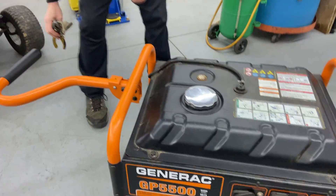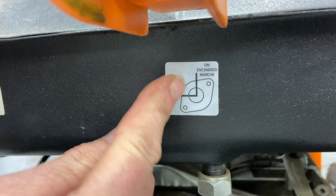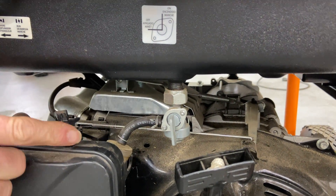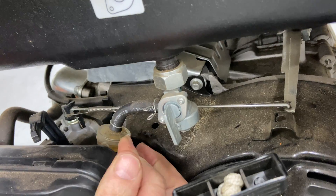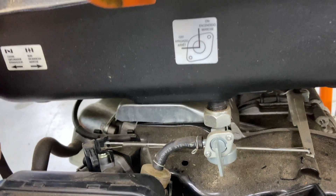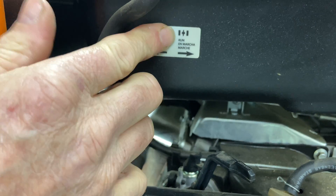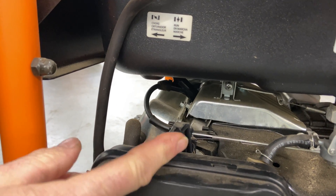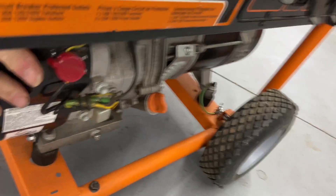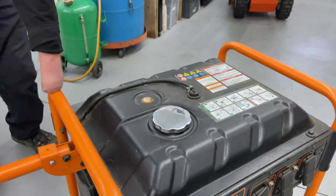We have good oil level, so now let's go to the fuel valve. It says off this way and on straight up and down, so I'm putting it straight up and down to turn it on. The fuel lines are in good shape and the fuel filter looks like there is gasoline in there. The choke: when it's in the closed position it's on, straight up and down is off. We need it in the on — closed — position. Also make sure the ignition switch, which is kind of out of the way, is in the on position.